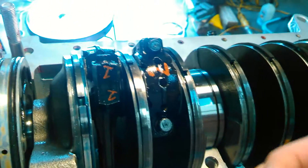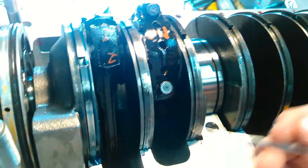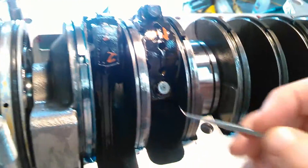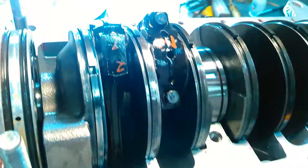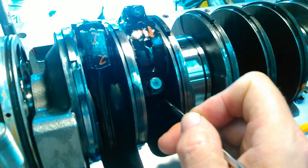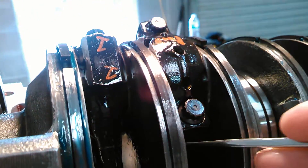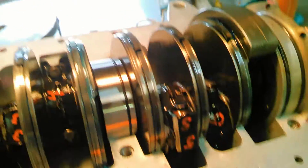Put the other bolt in, snugged it to the called-for 40 inch-pounds. Checked it — stayed there. Then torqued it again, I think it's only 21 foot-pounds. Checked it — stayed perfect. Then went to the full torque of 60 pounds, and now it's absolutely perfect. You can check it and it doesn't catch. Had to take this back apart to clean the gel seal out for the side, but that's worth it.